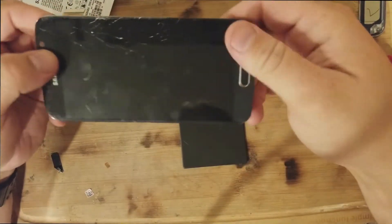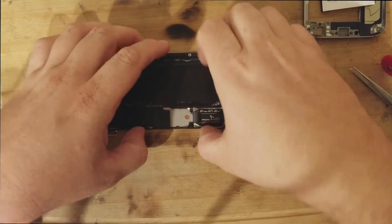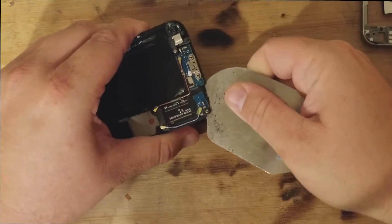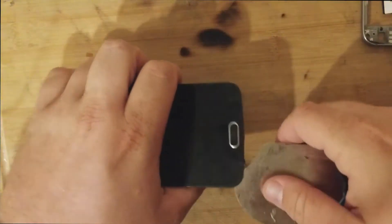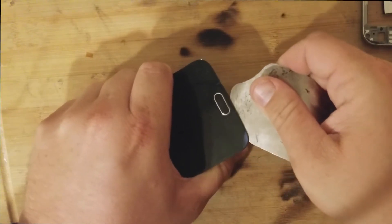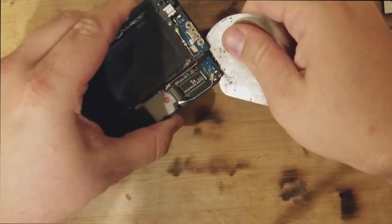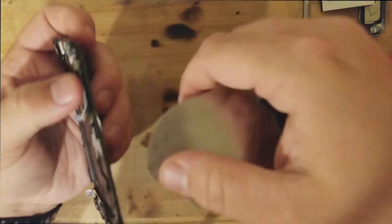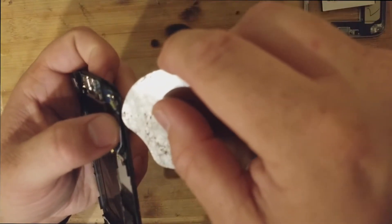It's warm and nice and hot to the touch. If it's too hot, grab something to protect your hands. I'm actually going to start right here. What we're doing here is we're actually slicing right above that cable — there's a spot right there too — and we're slicing right above this cable so we don't damage it. We're actually slicing it away from the adhesive, and this is going to be helpful in actually separating this screen. So we're getting under the LCD, which is critical that you hit the right spot. Hitting the wrong spot could definitely break the LCD and ruin your chances of having a good screen.